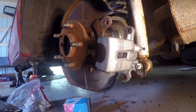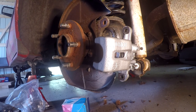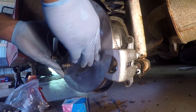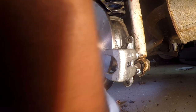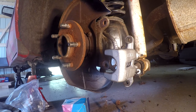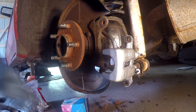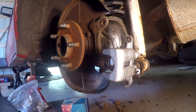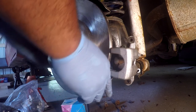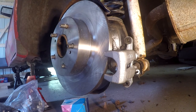I've cleaned off the brake rotor and we're going to go ahead and install this thing. It looks like it's rubbing against this back piece right here, so what I'm going to do is just straighten that out — bending the dust shield back into shape. We should have plenty of room for this now. Yep, no scraping, no moving — we're good to go.